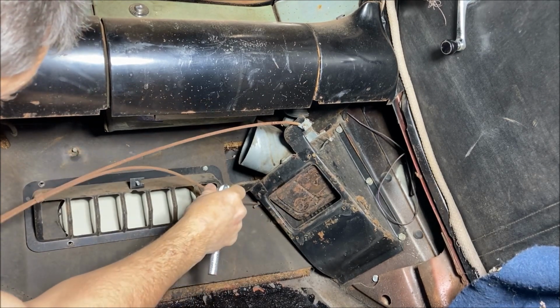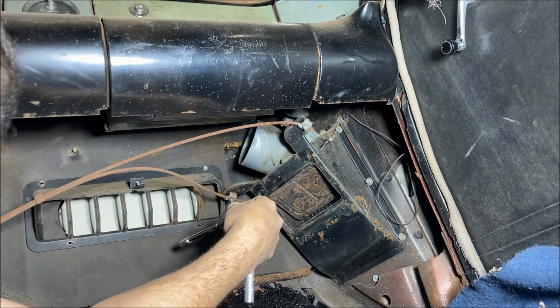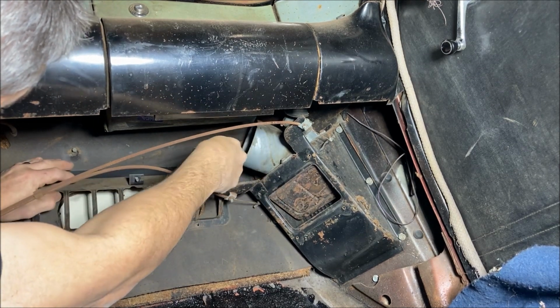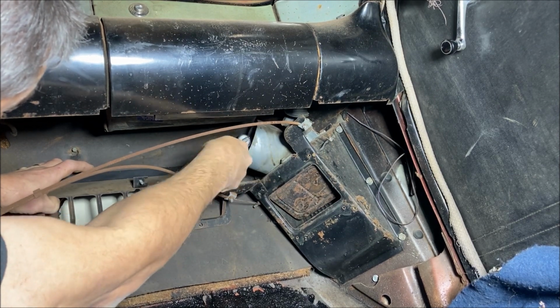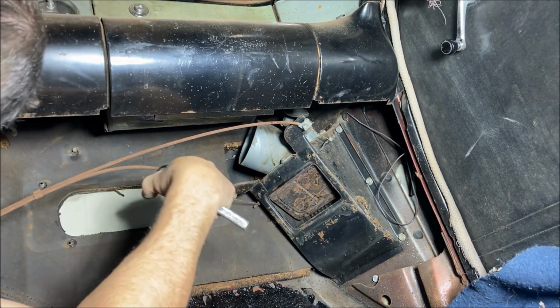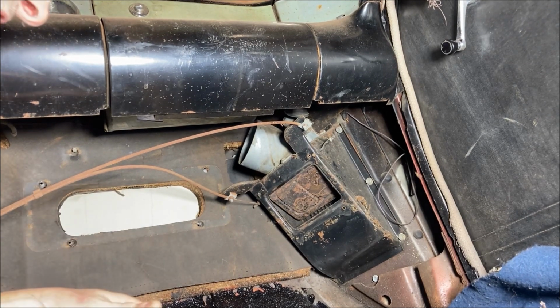And these are the only two control cables I'm keeping. There were originally 5. Two of them went to the vents, one on each side, which are not there anymore. The one on the left side, the power brake unit went where the vent was, so that's gone. And on this side, we blocked it off, so it's gone. And the last one was for the heater water control valve that was up there in the corner that we got rid of. Don't need that, because honestly, if I need the heat on, I need it on. I don't need to regulate it. So full-time heat is just fine.